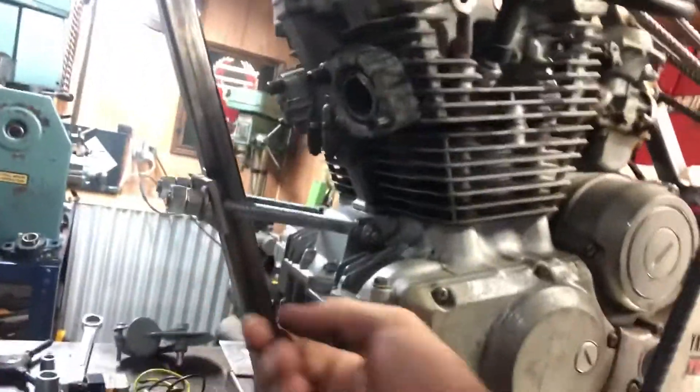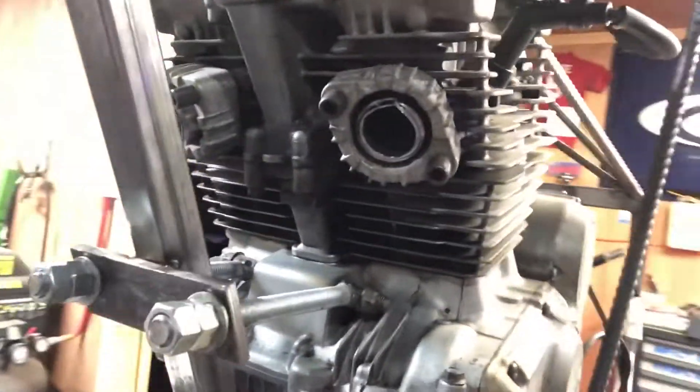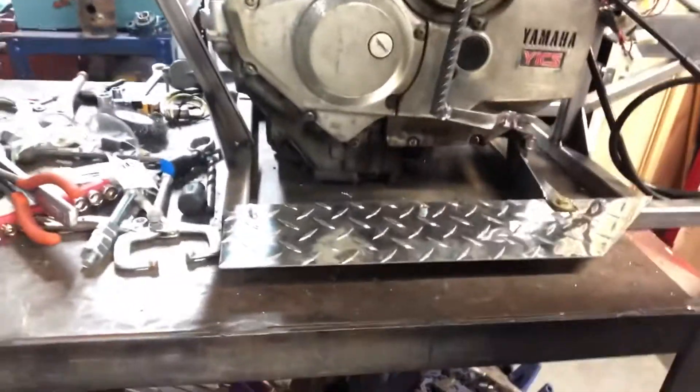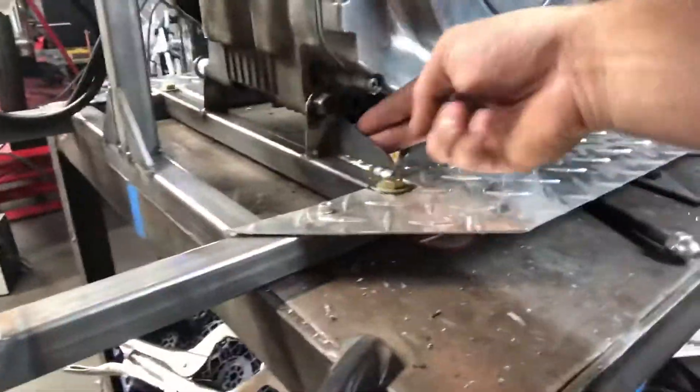Another day - I've just been going at it. I was ordering parts and just started working without filming - no big deal, nothing major. I got the nuts on the front motor mount - it works, you could actually crank it hard and there are only two tacks on it right now, so just wait until I weld it. I got the floor pans mocked on there, still gotta run the tubing on both sides, and I reinforced the bottom motor mount.